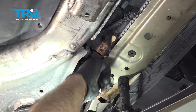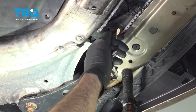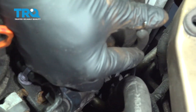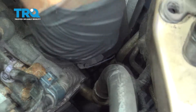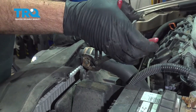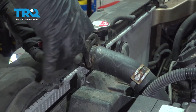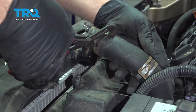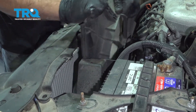I'm going to switch over to our gear wrench to give us a little more clearance. Once we get this out, go ahead and remove our AC cooling fan. Down along the side here, there's going to be a little connector pressed onto a little metal tab. I'm going to grab that whole connector and just wiggle it up and loose. With that separated, we'll continue to lift up our fan. Go ahead and loosen the hose clamp for your upper radiator hose. Slide this back, then loosen the hose itself using pliers, and pull and twist it. Work that up and off. Grab your radiator fan and work that up and out.